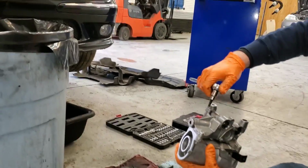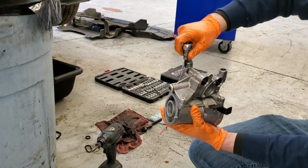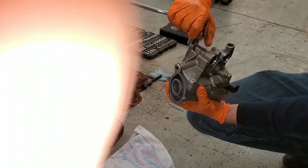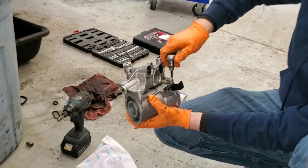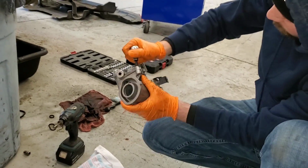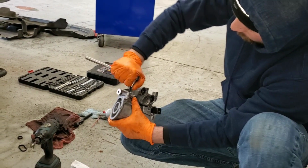So I'll start out with this middle one, as a head gasket deal. You'd want to start in the middle and work your way out, but that's typically if you have one big piece. Here we have two little guys. I think it really doesn't matter. Just more or less even would work great. See, I'm holding the ratchet. I don't have much leverage on it. They're snug. So I'm just going to snug them up by hand and supposedly crank on them a little later. So that's 1, 2, 3, 1, 2, 3, 4.